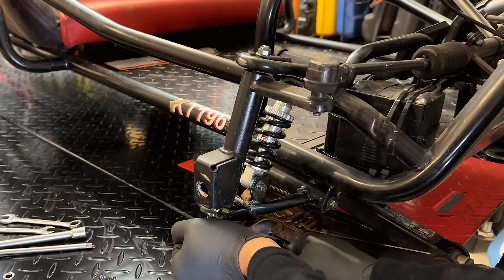It's hidden under this conduit right here, and everything's been tied in. The lights are all wired up, zip tied out of the way. We're going to pick up the negative through the body ground. We're picking up two, one for the lights and one for the engine kill. And then the three wires coming up, one of them is going to be full-time 12 volts. That'll power the lights. And also when you hit the start switch, it'll send the 12 volts back in this wire right here to the engine to engage that starter solenoid and crank the engine over.